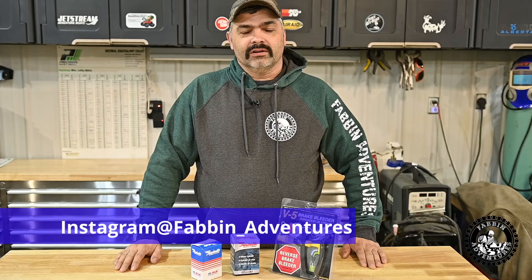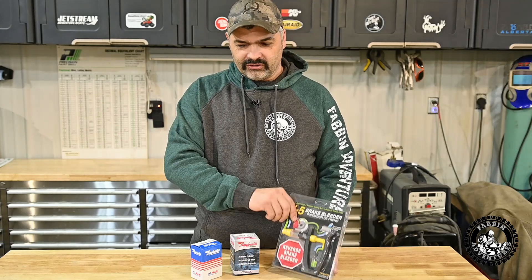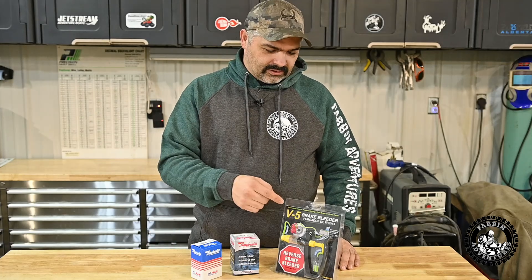So I got on the internet and started looking for ways — the one-man brake bleeders and blah blah blah — and I came across this thing on Amazon. It's called a reverse brake bleed system. Basically what it does is you bleed the brakes in the opposite direction. You attach this to your brake bleeder on your wheel cylinder and you pump fluid from your brake fluid container backwards up to the master cylinder and push the bubbles out. The theory is that the bubbles want to go up anyway, so you push it backwards. Guys are saying you can bleed your brakes in 30 minutes with this thing. All the Amazon reviews say it's awesome, but you also see that they're flimsy and they break easy and it's a gimmick. We're going to give it a go and try it out and see if it's actually the way to go.